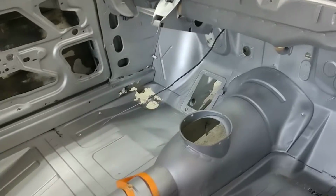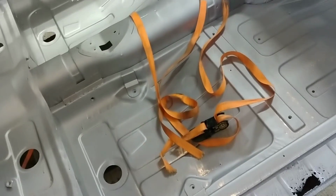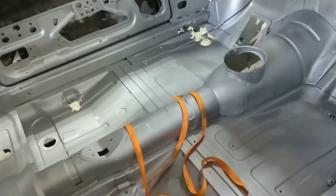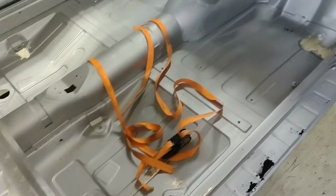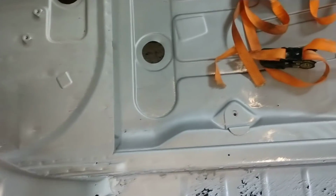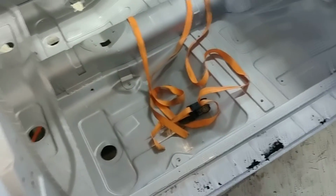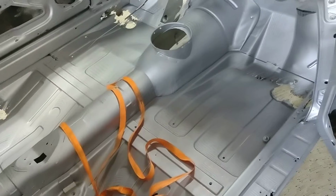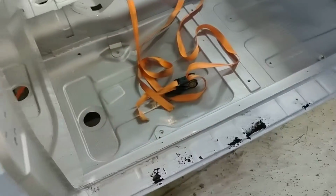So if the inners are gone like that, and we'd expect the outers, well, we don't expect, we know that we would replace the outers, then we'd also be replacing the middle rockers. So what we're looking at is replacing the floors, both sides. You can see that there's holes there. Technically, you could get away without replacing this one, but I think from a practical standpoint, we should replace them all. So the front and rear floors, the inner, middle, and outer rockers would have to be replaced.